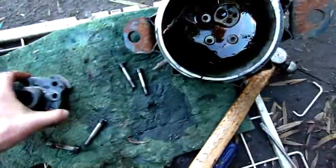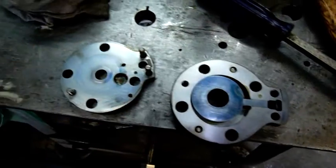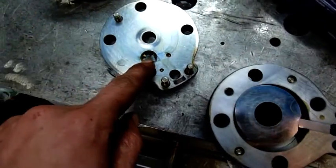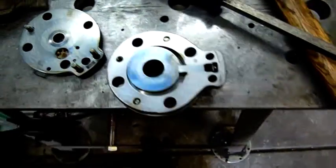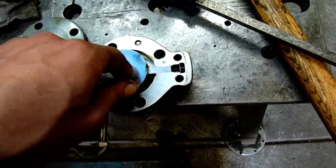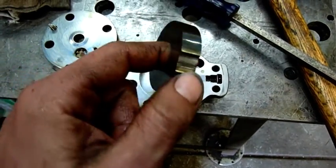Let's clean this pump up and dismantle it. That's the pump — it's open for the first time in about 50 years. I don't really know for sure how old this compressor is but the fridge it came out of looked 1950s-ish, maybe 60s. There's a suction inlet reed valve or disc valve with a little spring-loaded retainer. The vane is interesting — it has a flat spot on it. It doesn't actually rotate freely like normal rotary compressors do these days. It's fully hardened, a very hard piece of steel, and they've ground that notch into it for the vane.